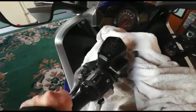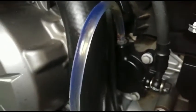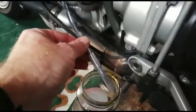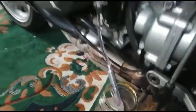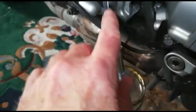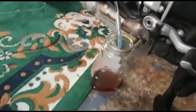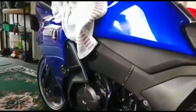There we are — took me about ten minutes actually, not too bad. Clutch back to normal, cap back on. Just another look at that position for you — can you see the focus? Just see where that bleed nipple is. These one-way kits are only cheap off eBay. There's a little arrow on there — that arrow tells you which direction it should be pointing, away from the caliper. For some reason mine came with a thinner bit, so I had to attach a thicker hose to it — not sure why that was, but it seemed to work okay. Not too difficult a job, just getting at that bleed nipple, that's all. Till next time, bye!